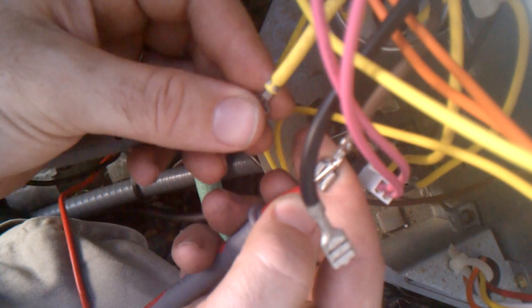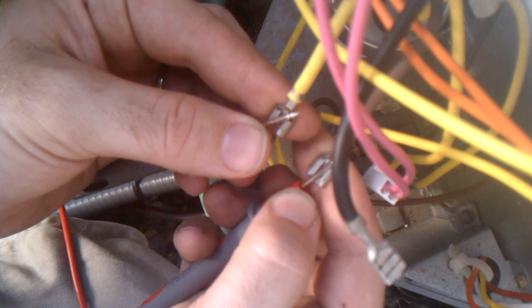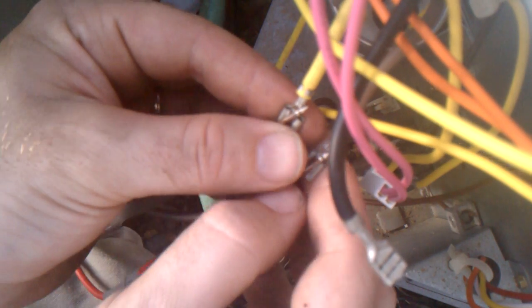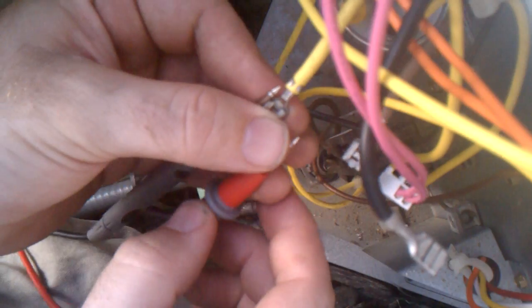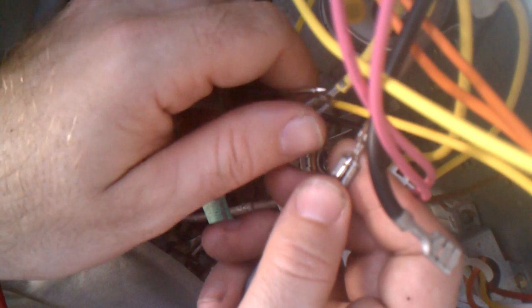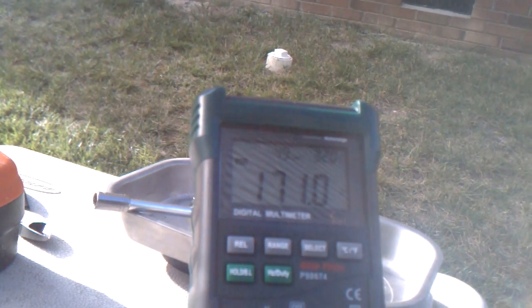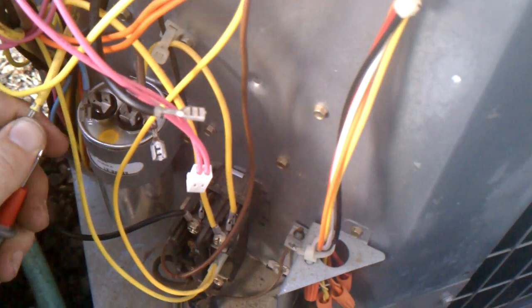So 125 and 45 together is roughly 170. Then you test the two outer wires directly and it should be around 170. And there's the multimeter — about 170. So the windings are probably good. You're just kind of narrowing everything down one at a time. Next, select microfarads on your multimeter and you're going to check the capacitor.